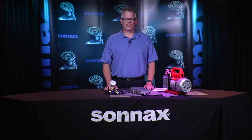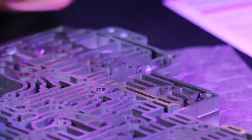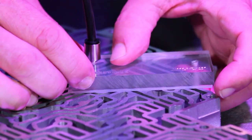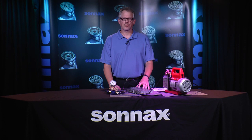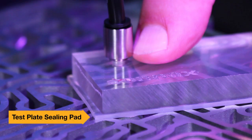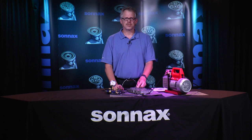Let's see if this PR valve and bore are worn enough to cause a pressure problem. I'm going to take the test plate with the rubber pad attached and place it on top of the valve body casting, making sure that it completely covers the circuit area highlighted in red on the guide. At the same time I need to leave the neighboring port uncovered so that the vacuum pump has a cavity to draw air from — otherwise we will create a perfect seal and accidentally get a false high reading of 25 inches. You'll notice I'm using a rubber pad, which is a cleaner and quicker alternative to assembly lube. The area I'm checking is the balance side of the valve, because wear here will cause a lot of pressure-related symptoms.